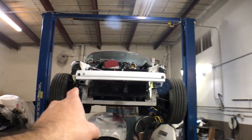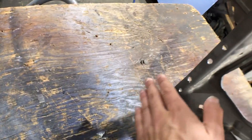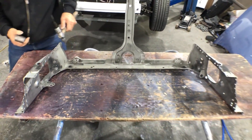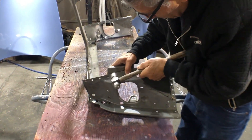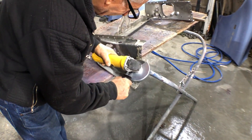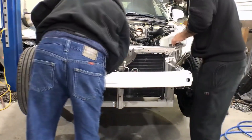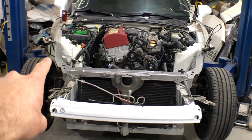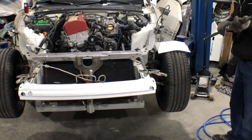So right now we're going to lower the car and then do the upper half of the support. Alright guys, we got the support on the table. Let's go ahead and clean up all this area right here — anywhere you see holes, that's where it's going to be welded back on from. So we've got to clean it up so the weld will hold nicely. All the spot weld locations are nicely flattened out. The top part of the support is now on the S2000, nicely clamped down with the vice grips. I'm going to do one last measurement prior to the welding just to make sure everything is good.